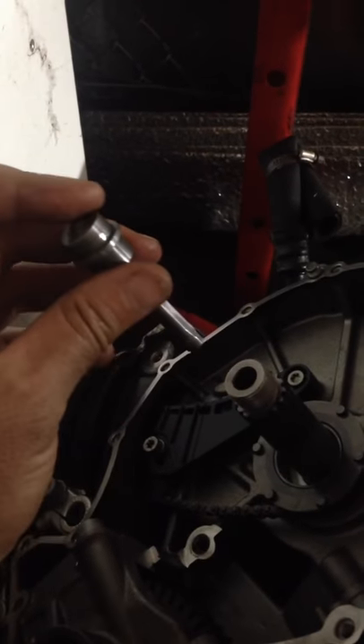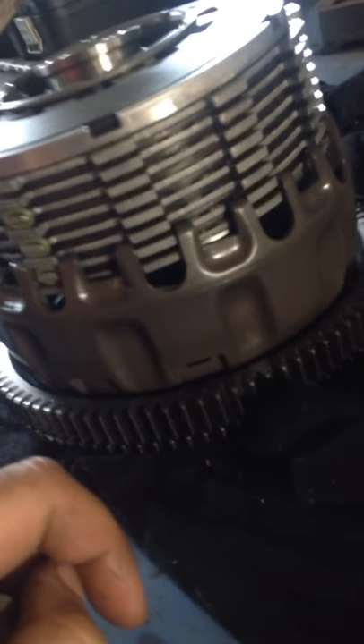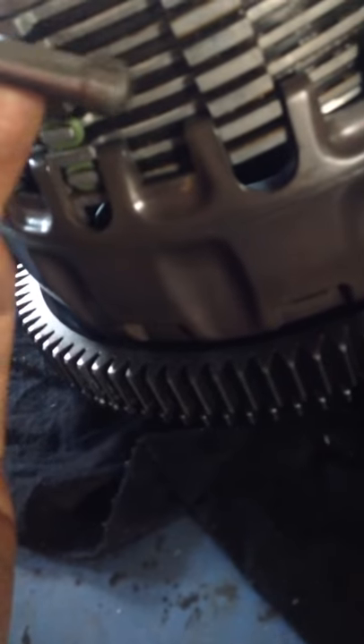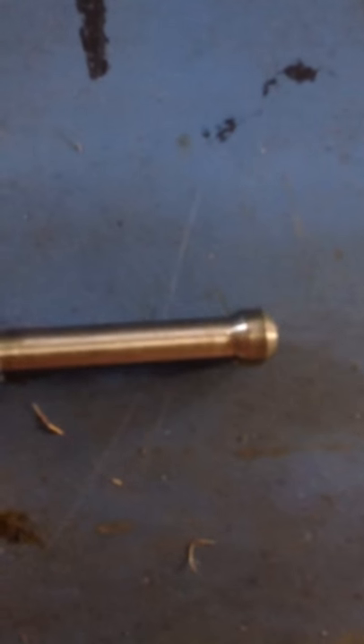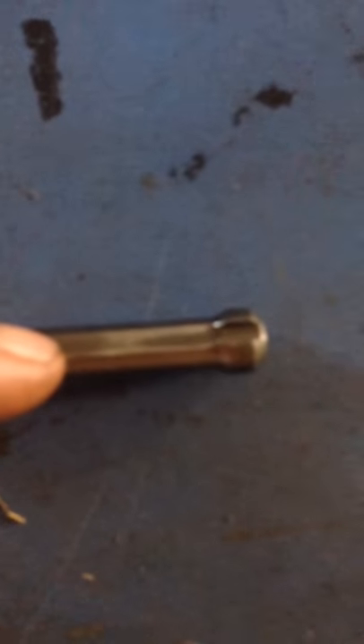That's just not enough. Considering how many clutch plates there are — there are plenty of plates — all of this is supposed to be oil-fed through this tiny little channel. So I got on a lathe and I actually machined it down to pretty much the thickness of where the channel is.